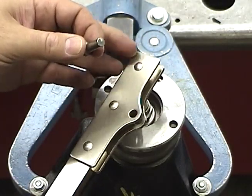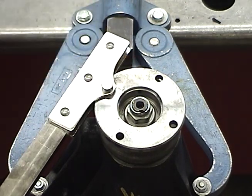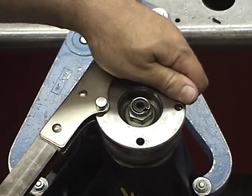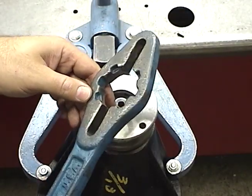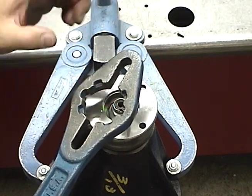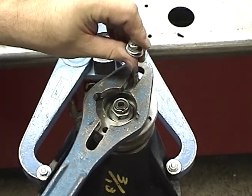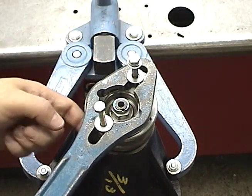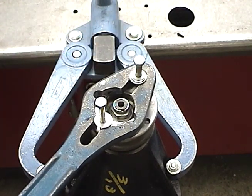The pin pulls out. It's designed to slide in through one of the mounting holes. Pin goes in, and now you can hold it from going either way. This holder is actually designed for the yoke style flange, however it can still be used for this type of flange. We simply need to use a couple of mounting bolts, place a couple of nuts on the bottom side, and this will hold the flange from spinning.